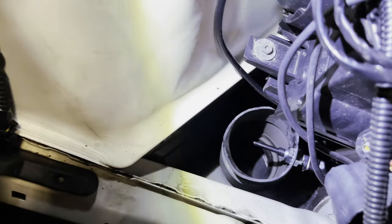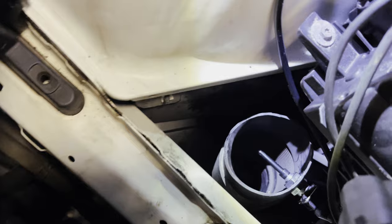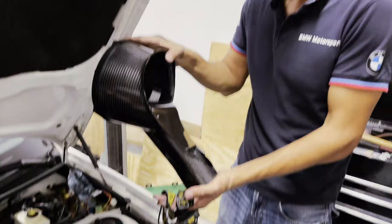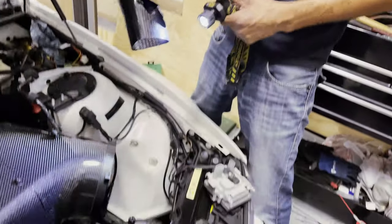So now we've got the location for the intake air temperature sensor — and we did not drill the carbon fiber. What we ended up doing is taking the fog light ducting that goes to the OEM air box and trimming down the beveled edge — had to take about three inches off. We're able to get the sensor to go through, and it gives us enough room to where we put it in there and it physically just lays there snug. In essence, it still gets cold direct sub air to it, and further from the engine means better temperature. Sweet — we didn't have to drill through it. Cooler temps.